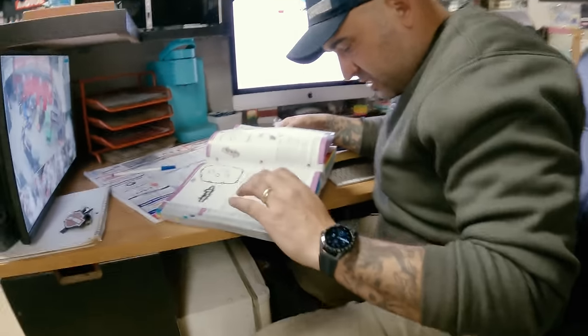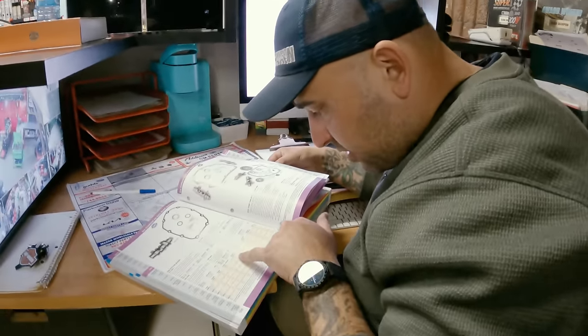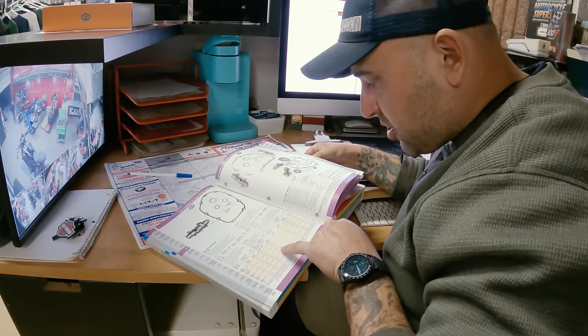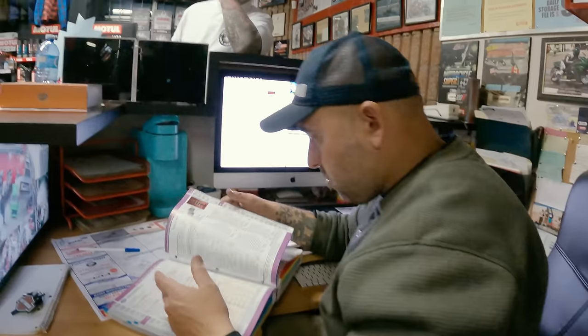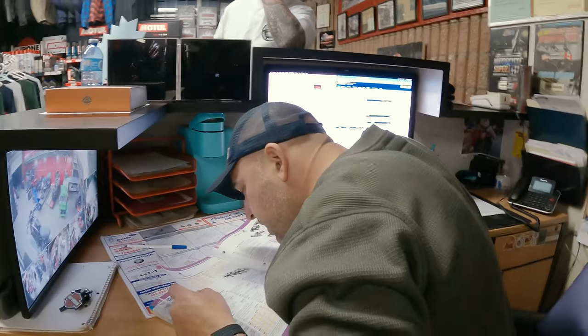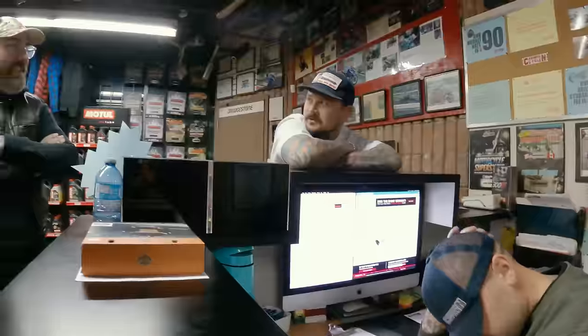Their actual cam size depicts the intake valve lift, almost, not on the 465. So on the 540, it's actually intake valve 540. Whereas what we're going with now, the lift is 578 intake and 592 exhaust. If what you have now works great, and we know it's making a little less power than it could have with a bigger cam, totally. If you're gonna go with the heads, then it only makes sense to go with this bigger cam. This bike's gonna be nuts. Okay. It's gonna make sense that it's in the performance section in Montreal now, yeah.